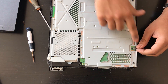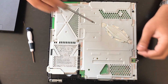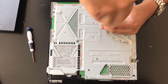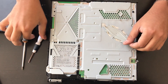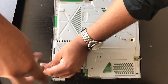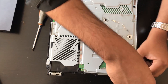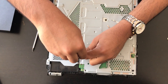We're going to lift the fan connector upwards gently, because it's very easy to break, and we're going to remove all these screws here, including the Phillips screws that hold the heatsink brace. These screws are Torx T8 in case you're wondering.